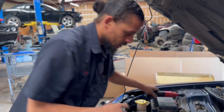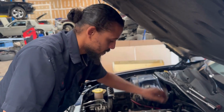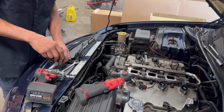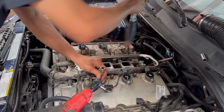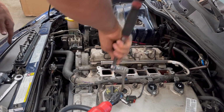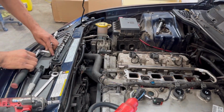All right, so now I'm gonna take 2 and swap it over. Did it have a misfire on 5? Yes. Okay. Don't want to get anything mixed up here. So if the misfire goes to cylinder number 2, we have a bad coil. The plug, I don't see any problem. It is new, like you stated.